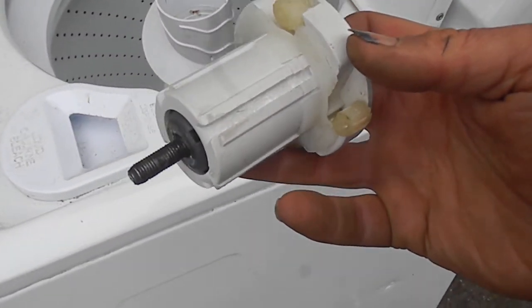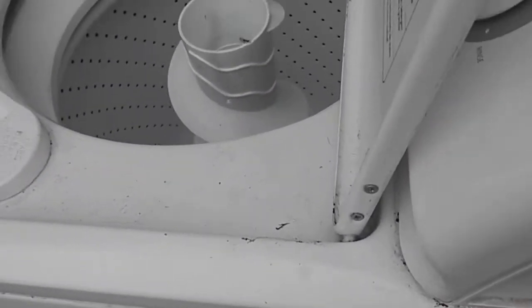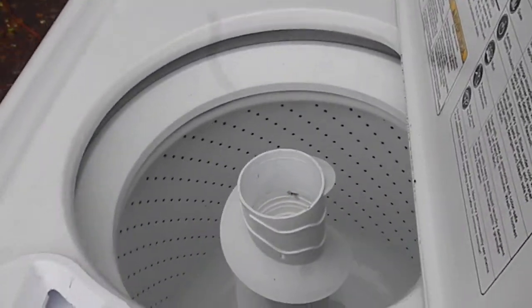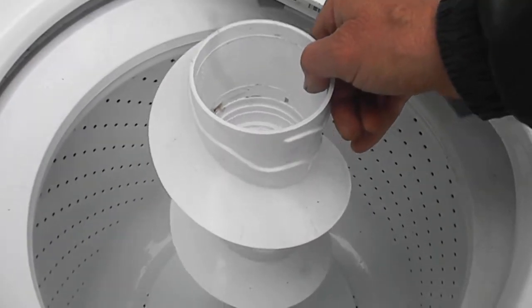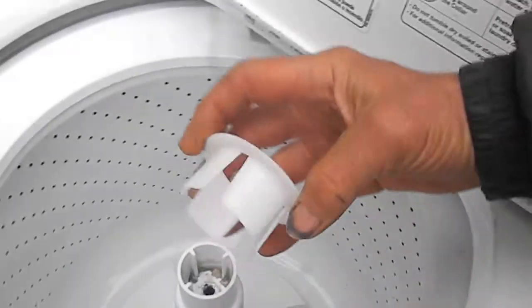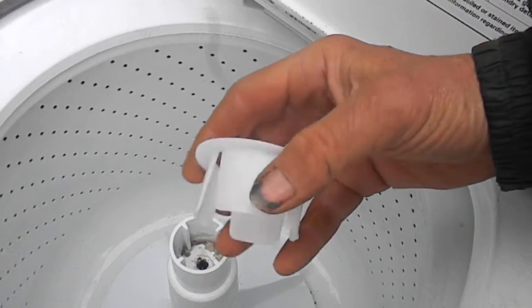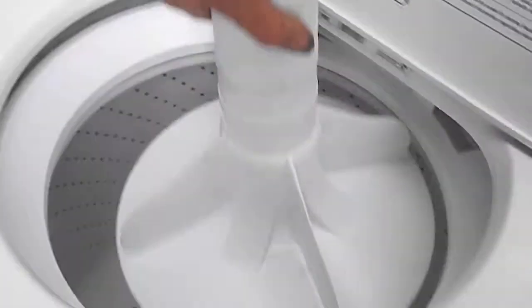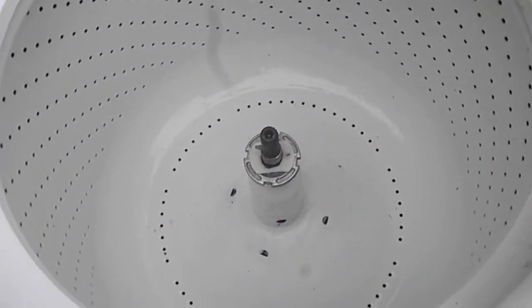When I deal with the agitator, I usually take it all apart and try to clean it. I use this cleaner here — thank you Cash and Carry in Arcata for that donation. You can look inside and clean up your agitator real good. This slider here is what allows the agitator to smoothly move, so make sure you have a good one. Pull your agitator right off and clean underneath it, as well as the bottom part of the agitator.